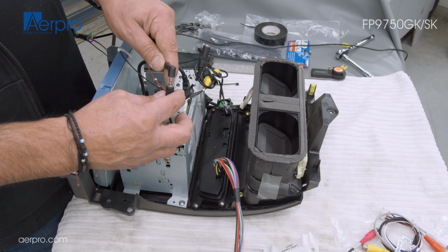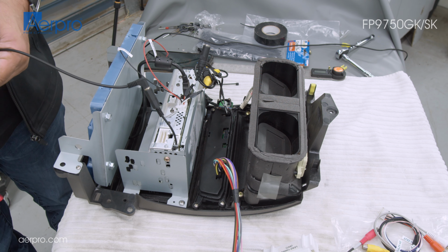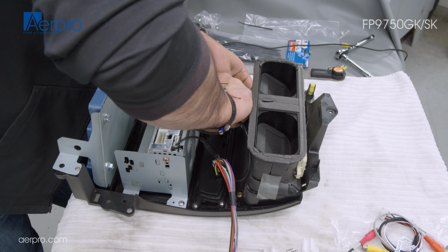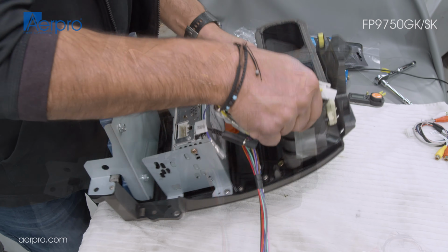The next step is to connect the universal patch lead to the control unit and the head unit, ensuring that the correct wire loops on the back of the connector are cut correctly depending on the head unit being used. This step must be done before the system is connected to the car and receives power for the first time.